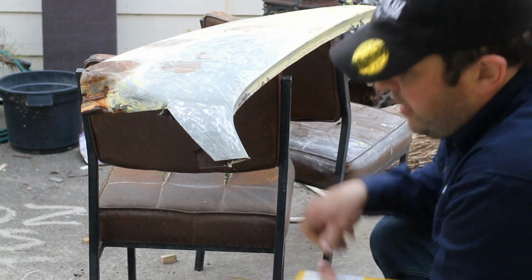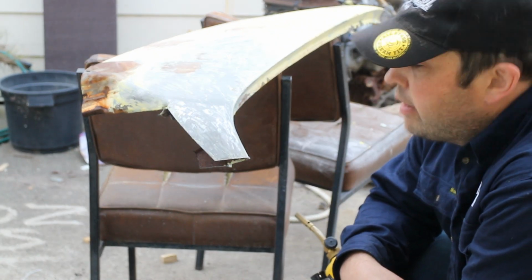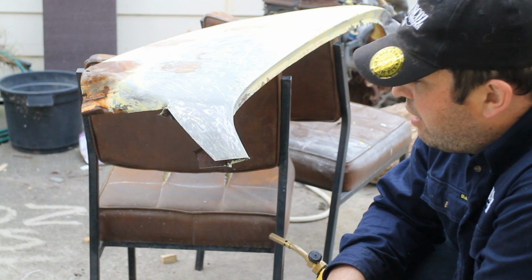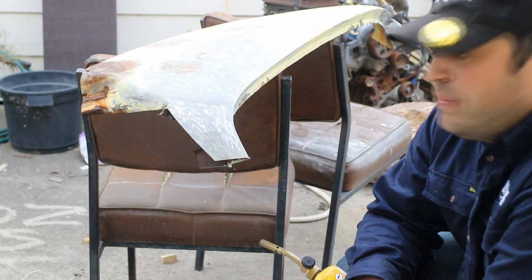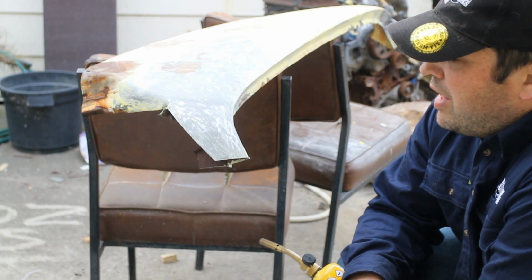So what I've got down there is a hatch off for an old speedboat. Now it's just got 20 or 30 mils of water in it, because when all this lead falls down, you want to quench it so it doesn't just stick to everything. Now, if you do this above your cement, it will just stick to the cement and, well, be troublesome. So I'd rather just catch it in the water and then I can just send it off to recycling later.